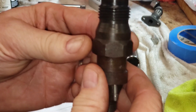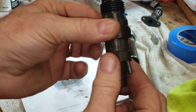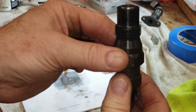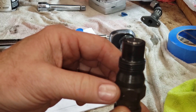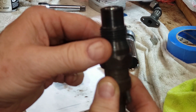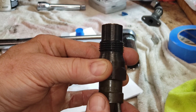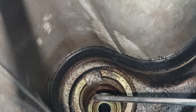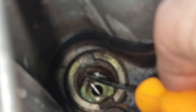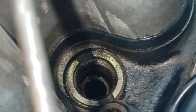To get this thing back in the car: put it in your bench vise upside down, clamp on the two flat marks, put your socket over the top — be careful not to mess up the tip — and torque this half down to the appropriate setting. This injector is ready to go back in the engine. We've got to remember to take our old heat shield out of the bore. Let's see if we can get it out with this tool — there we go, not a problem. That's the dirty details down in there.